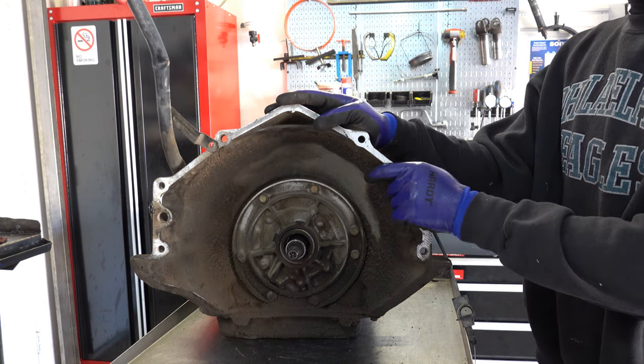I don't, but if you do, you'll still be able to hear that faint hissing sound coming from the forward piston. And then again, your overrun piston is going to be replaced with a bonded version. Bonded steel and rubber. That's what the 4L60Es used after '96, so 97 and up. All right, that's forward drum.